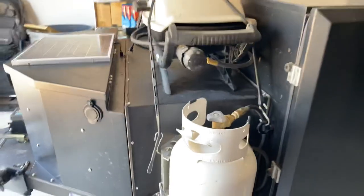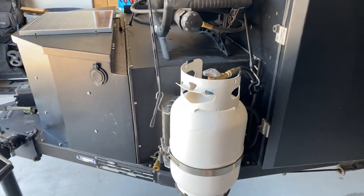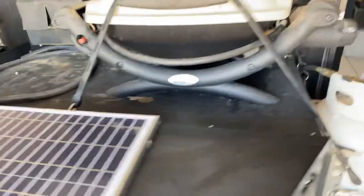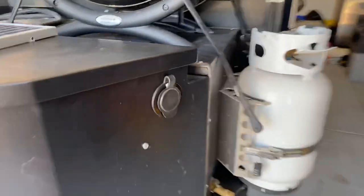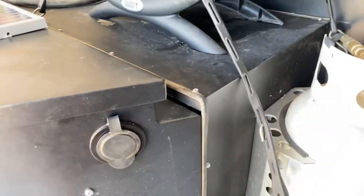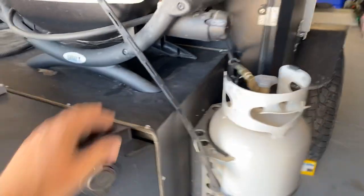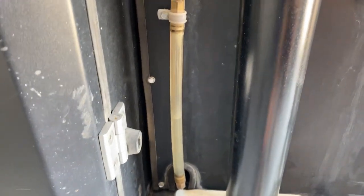For water, water was an interesting one. For any of you that have studied the Smittybilt Scout trailer, you've noticed that we don't have the spare tire here — it's actually off the back. We knew we wanted water and didn't want to take up any precious cargo space inside the trailer. So a 30-gallon RV water tank actually fits perfect — it's flush on both ends. We have a little half-inch square-tubed frame that we built that fits around the water tank to keep it in place. Got that powder-coated and then got some sheet metal formed and powder-coated. My dad helped me with all that. That holds the water tank in place at 30 gallons, and we have a height measure so you get an idea of how much water you've got.